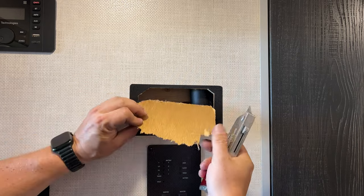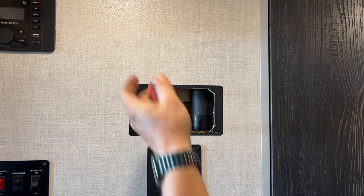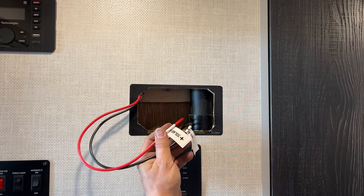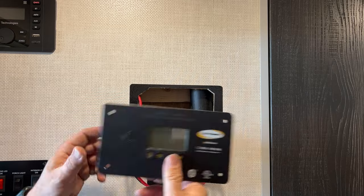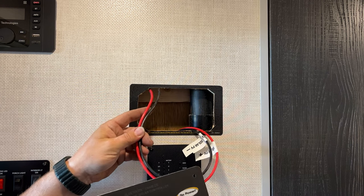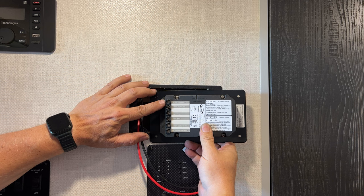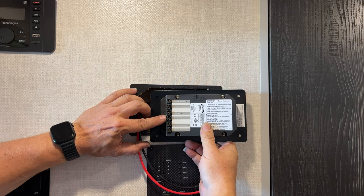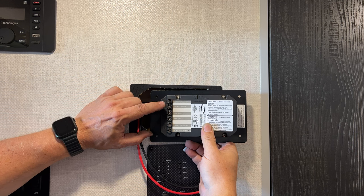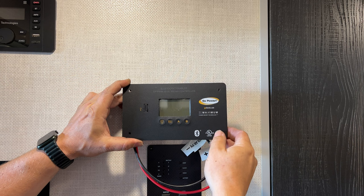It looks like they have some kind of laminate over a thin piece of wood. The wires are tucked back in here — here are the two that I was looking for, even labeled solar positive and negative. The way this works, you just cut these wires in half and put the solar charge controller in between. This end runs up to the solar panels and this end runs down to your batteries. On the back of the controller we have battery positive and negative, and then the solar panel positive and negative. If we wanted to charge a second battery, we could — the controller will charge the first battery completely and only then start to charge a second. I'll cut this wire, get this installed, and then we'll go up on the roof and install the solar panel.